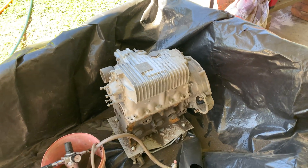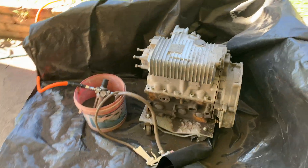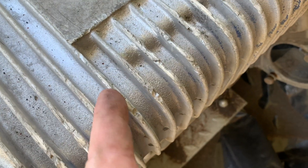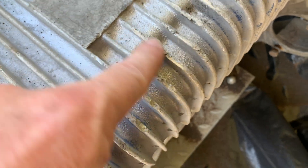As far as plans go, this is a good plan. Most of the other sandblasting I've done in this little cabinet — I just took all the hoses out of it and set up a couple of bits of black plastic sheeting. The sandblasting media basically goes into a bucket and it's actually coming up all right. I don't need it to look perfect, I just need to get all the loose bits of paint off. I was doing it with a wire brush and it just killed me. I won't be getting every single bit off because I'll be painting it silver anyway. I filed down all these sides to try and clean them up a little bit — I didn't try and recontour all of it, it's not worth it.